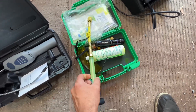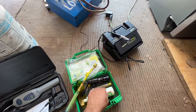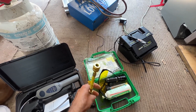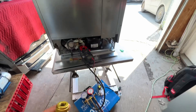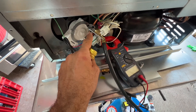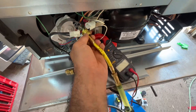The third method uses UV dye. It comes in little small package bottles like this. You're going to open it, hook it on this coupling, and install this on the top. This part goes on your access valve, which is right here. Not all fridges have this access valve — it's called a piercing valve — but you can add one of these piercing valves on the side of the compressor and then connect this coupling.